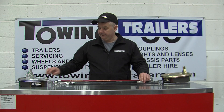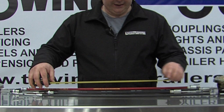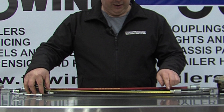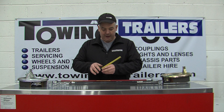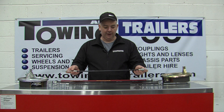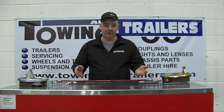Once you know the size of brake cable that you require, you then need to know the length. The length is the measurement of the black outer or red outer, measured just over the bushes. For example, this would be a 530mm, measured from there to this nut. It can vary slightly, but this is quite easily a Knott detachable 530mm long. All Knott brake cables are in 100mm increments, such as 530mm, 630mm, 730mm, up to over 2,300mm.